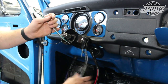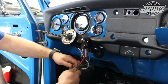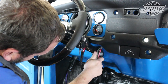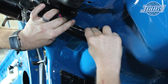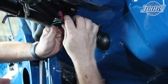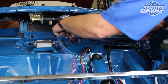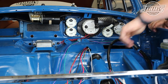Working our way forward in the car, we install our new turn signal switch, re-route the wires from it in the ignition switch wire sleeve, and run all the wires up through the original wire grommet at the bottom of the trunk. All the wiring is tucked up cleanly along the steering column. Here in the trunk, we start by routing the additional wires for our gauges up to and along the back side of the dash to the corresponding gauges.